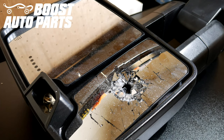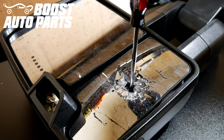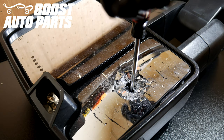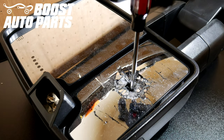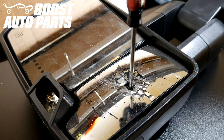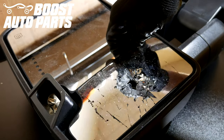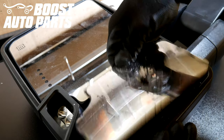Some aftermarket mirrors do not simply snap off. Instead, punch a hole in the center of the lower glass, then using gloves, carefully remove the screw in the center of this hole. In the center there's a Phillips-head screw — just slowly unscrew it. We do recommend wearing gloves throughout this process to make sure you're safely protected. Once that screw is fully removed, lift the lower glass off, making sure not to get any glass anywhere, and safely discard the lower glass.